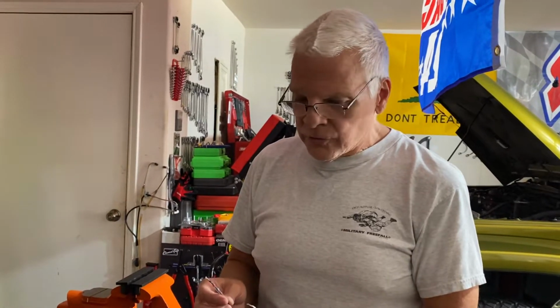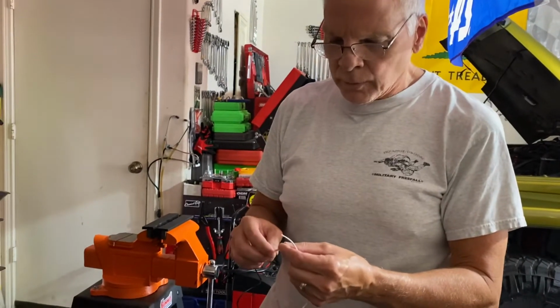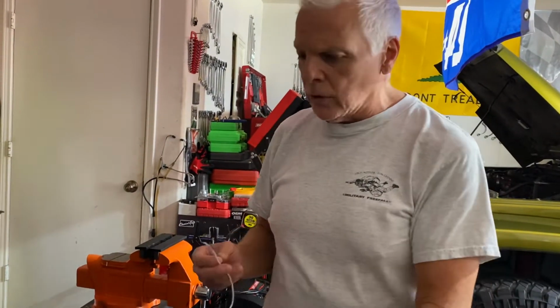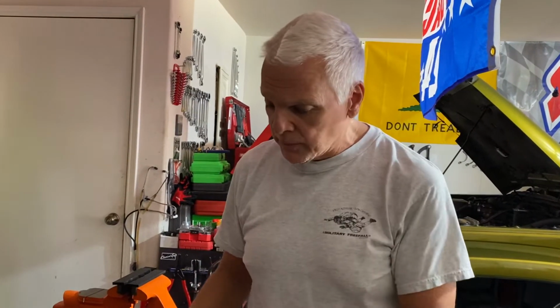Okay, I thought I'd show this little thing that I've found recently. Normally, when you have wiring issues, like when I wire up my lights from off-road vehicles, I do what's called a flyover, where you take the wires and you make little rabbit ears and fold them over, and I solder them, and then I'll take some heat shrink wrap tube and go over the top of it.